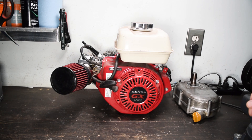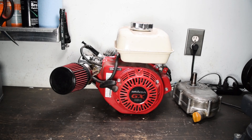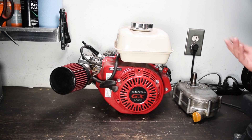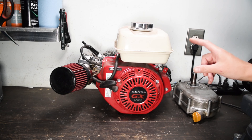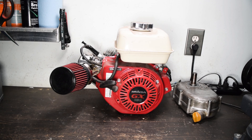This thing's already been used for a go-kart so it has a normal style mower carb on it. I've only heard this thing run maybe a couple minutes when I first bought it — it was only $100. It's a 160, which isn't a lot, maybe five and a half horsepower. Once we're done that might be a little bit more, but we're not messing with timing so it's kind of arbitrary. It'll be a good little engine; the main priority is reliability and serviceability. I don't want to replace a clutch every year. I'd rather do a wet clutch where I can just buy discs if I have to. These things are bulletproof, and at $100 you can't go wrong. I'd much rather have this than any sort of clone.